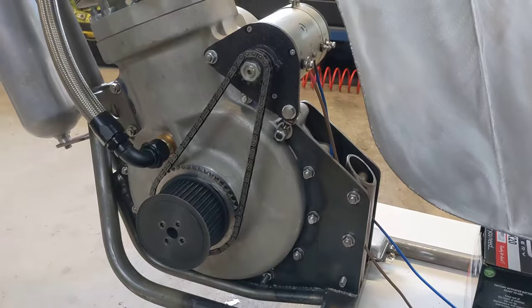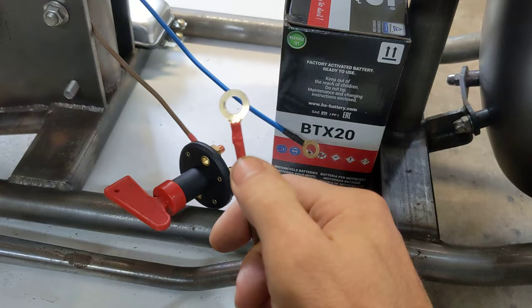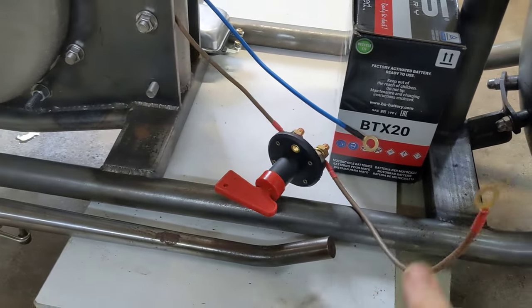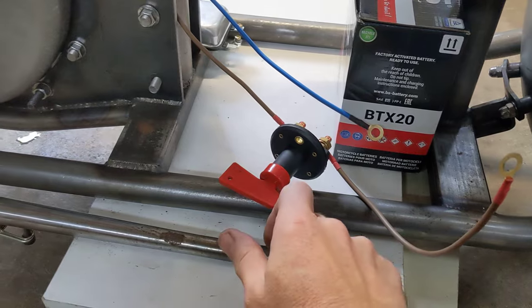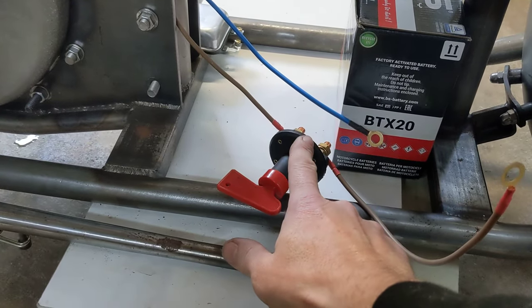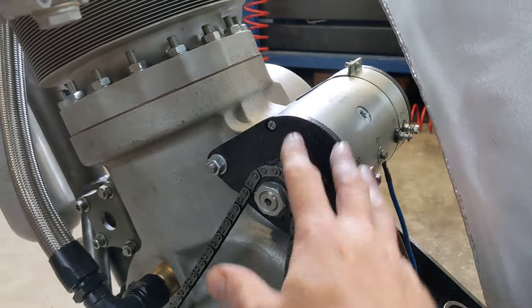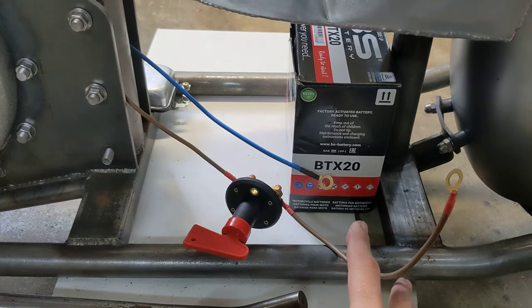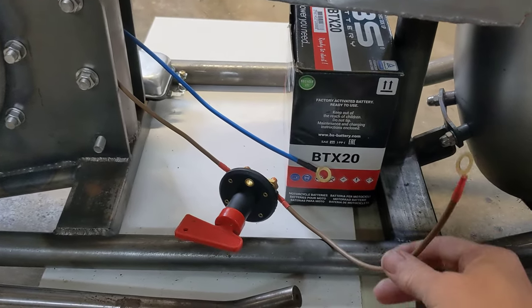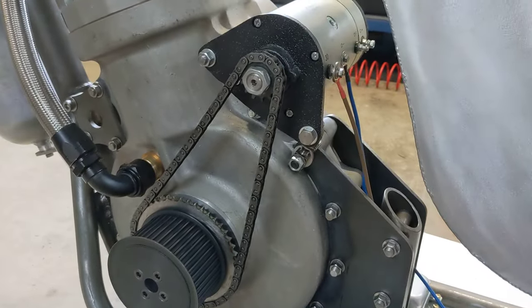Back to the bike and the starter motor which is here. A bit of a jury rig with what was left lying around. There's no reason you can't just make some nice connectors and put a bit of heat shrink on. I also had a pair of side cutters kicking around, so that in the unlikely event that the heavy duty switch fused on, I didn't want the whole thing melting the wires or damaging the Dynastart if it wasn't rotating and I couldn't disconnect it from the battery. The side cutters were a belt and braces — I could just cut those wires quickly if needed. They got a little bit warm because they're only six mil, not really up for the job, but just for a very quick test to make sure it would turn the engine, it worked quite well.